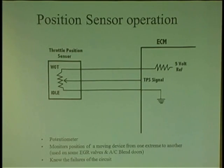The other ones are potentiometers. So we talk about thermistors, potentiometers. When I was a kid working on cars, I used to go to the back window and put my ground somewhere on the heated grid, the defogger grid. I'd go, wow, it's bright. Oh, it's getting dimmer and dimmer. Oh, it's out. That was the early design of a TPS. It's a potentiometer in one respect because you became a potentiometer. Here's your 12 volts, here's your ground, here's your resistance, and you are the potentiometer.